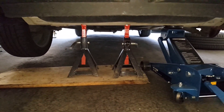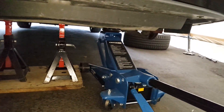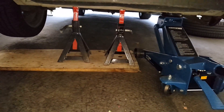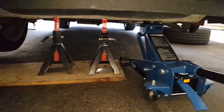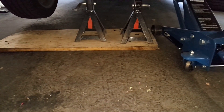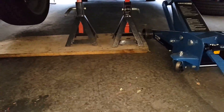For the next series of tests, we're actually going to be looking underneath the car — we have to jack up the car and remove the wheels. We've got to check both sides, because just because there's wear on one side doesn't mean there's wear on the other. Before we go ahead, I just want to stress: make sure safety first, you guys are jacking the car up properly. In this case here you can see I have two jack stands and my jack all supporting the car. I've also put wood down — if you have an asphalt driveway, having most of the weight on the jack stands will cause it to sink in, so this is just a measure I take to help balance that out.